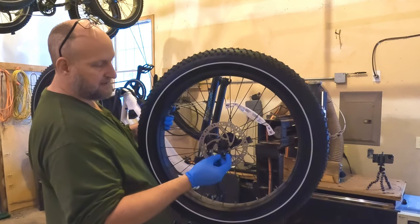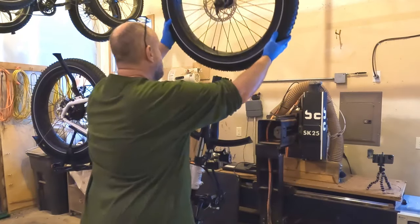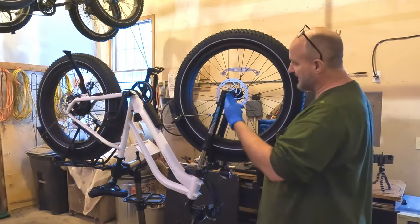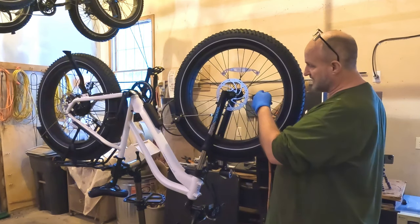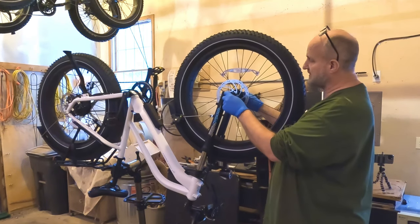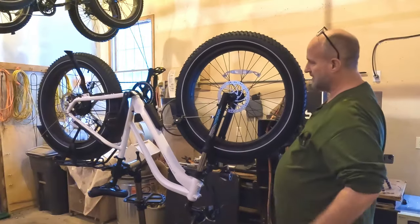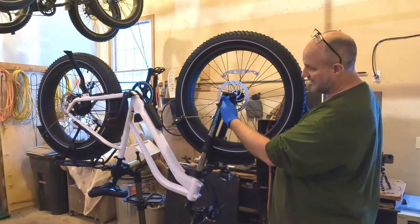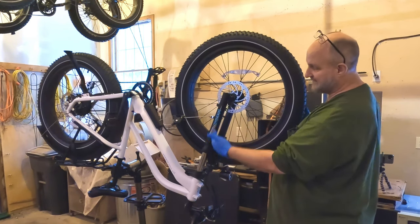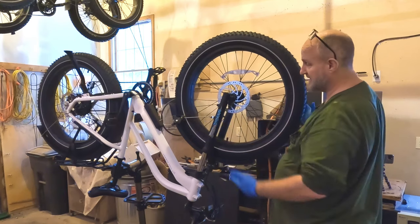I put the skewer back in. I like the cam side on the same side as the rotor — that's just the way I do it. I don't know if there's a set rule but from what I've read, that seems to be pretty common. Remember when you put your skewer back in, there's a conical spring — the small side goes inside towards the tire and the big side goes out. Make sure the axle is set down in the forks, then tighten up the back side with a lot of pressure. I always put the cam side along the top side of the forks — that way if it comes loose and falls off, you can visually see it while riding the bike. If you put it down and it comes loose, it can flop around and you won't be able to see there's a problem.